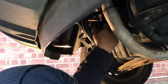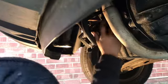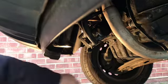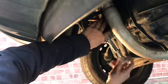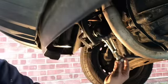See that spinning on? And that oil on there. What you do now is just hand tighten it on, as tight as you can with your hand, until you can't do it anymore. Here we go. Reach for the tool. Now, these do not need to be majorly tight. They obviously need to be tight to make a seal, but the rubber gasket in there is what's making the seal on here. So you do these tight, but not over tight.